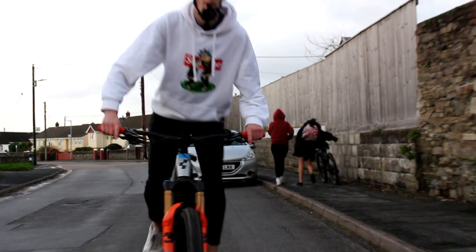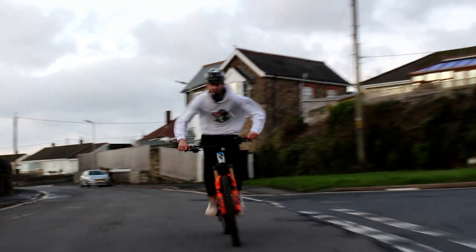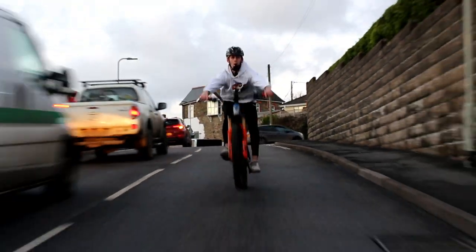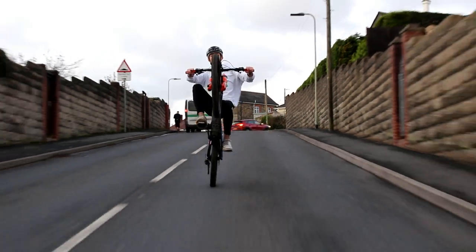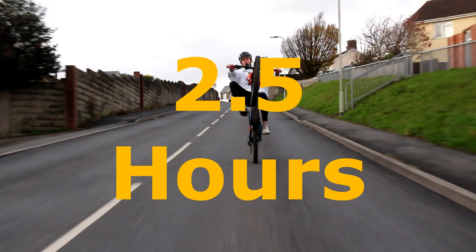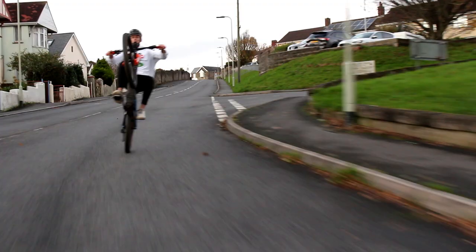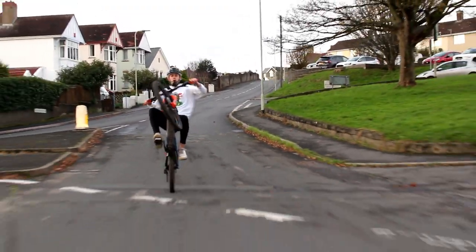What charges this bike? Depending on the range you go for, if you go cheaper you'd get a two-amp charger, which charges in about five and a half hours. With this one being a 625 battery, it takes a little longer. As you spend more money you get a better charger — this one comes with a four-amp Bosch charger. You can get two-amp, four-amp, or six-amp. Six-amp charges the 625 battery in about two and a half hours, four-amp in about three and a half to four hours, and two-amp in about five and a half hours.